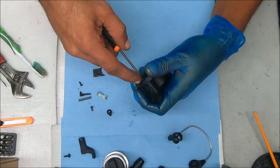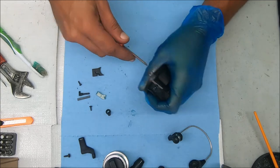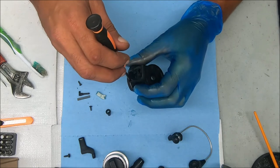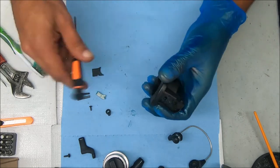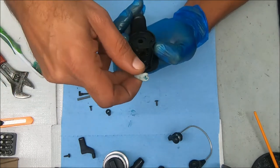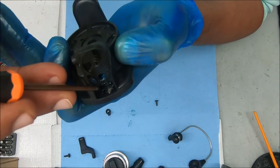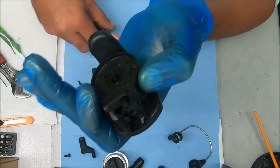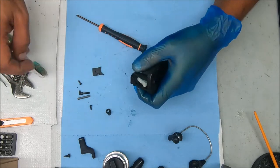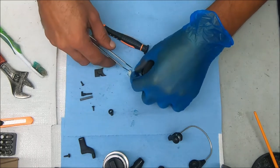Notice I kept all these screws separate so I know which ones go where — there were a lot of different size screws on this. Now to put this piece back in, we're going to line that trip arm, putting it kind of in the middle, where it's sticking out. Because we want to line that up where the gap in this piece fits over that end of the lever right there — you can see inside there. So I'm just going to drop that in, making sure I watch it as I put it in to make sure it's going to go over that.